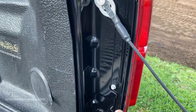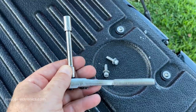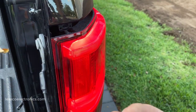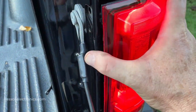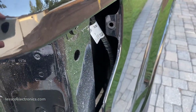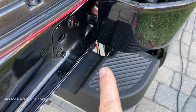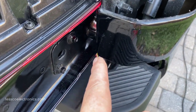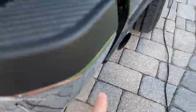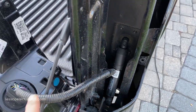To remove your tail lights is pretty easy. You just take out these two bolts right here — two 8mm. You can pull the light housing straight out. After you take out the two nuts you just want to pull it straight forward. It'll make a little crack, don't let it scare you, just pull it straight out. It'll come out just like that. It's just that clip right there holding the whole thing together — one down there, another one up there, and the two screws over here. I dropped the wiring down and on the other side I'm going to take some wire loom and run it up behind this unit that keeps the gate from slamming.